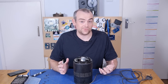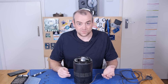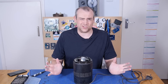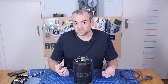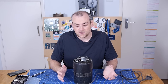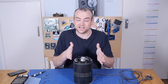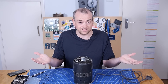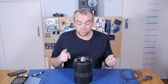One of the coolest uses for induced airflow is inflating the evacuation slides on an aircraft. They're basically filled by rocket motors because there's a limited time frame — I think it's two seconds from nothing to fully inflated, and these things are huge. The exhaust from the rocket motor is obviously hot and would melt the plastic. So they use the rocket motor to make high velocity gas, but use induced airflow to suck in cold air around it. That mixture of combustion gases and induced ambient airflow is enough to fill the slide in less than two seconds.